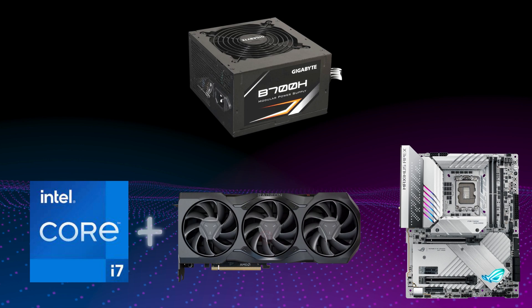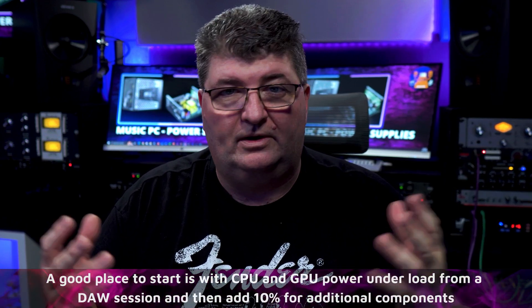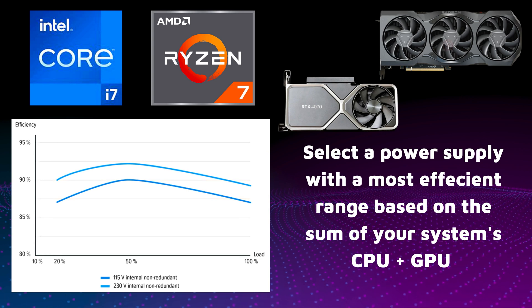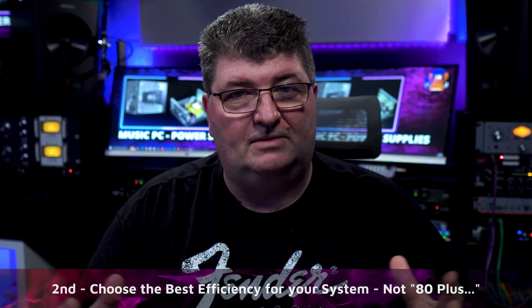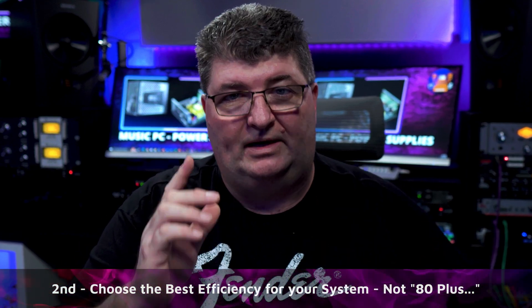The answer is I looked at how much power I was actually using. I found that at max load with a good session running in a DAW, I could be sitting around 400 to 420 watts. So I thought, that's what I really need — now let's find the most efficient power supply in that delivery range. Looking at the Seasonic GX1000, I found that was in the sweet spot, where we had the most efficiency. I suggest that when you choose a power supply, look at your system, the power you actually need, and find a power supply where that sits in the sweet spot as well.